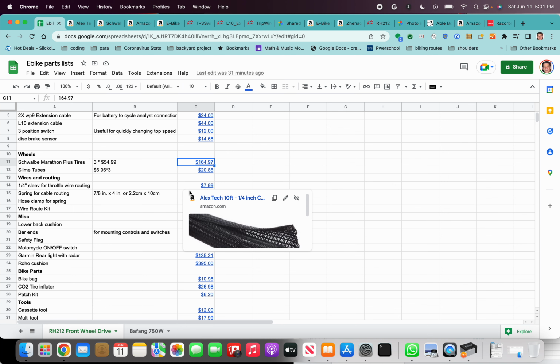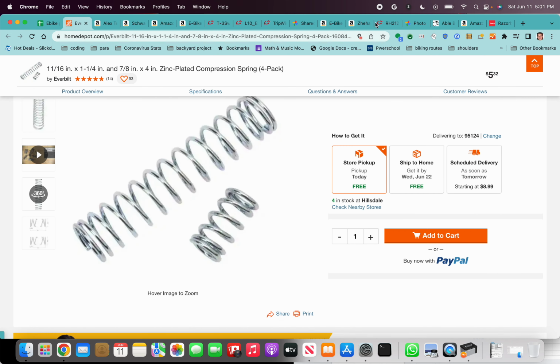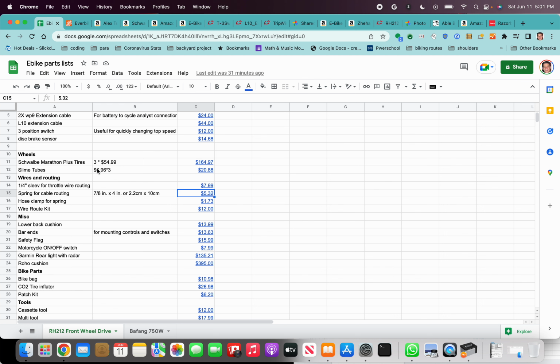This one looks better. I like to have this spring here. I got it at Home Depot. I use it for making sure the wire doesn't break, you can see it better here. It's a common breaking point for the brake cable on these top end Force 3s, especially now that the brake line is connected to the throttle wire. It's a little bit of extra weight, a little more mass pushing forward every single time you pedal. Adding this spring, at least on my bike, has extended the longevity of both the brake cable as well as the throttle wire.